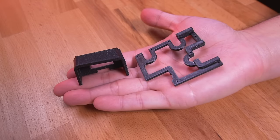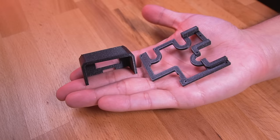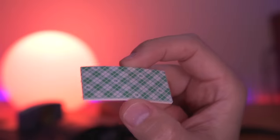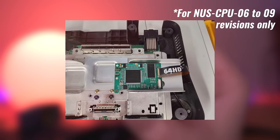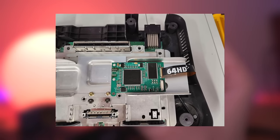Also included in the kit are both the AV shroud with a cutout for the mini HDMI port, as well as the booster bracket to support the HDMI daughterboard. The shroud was licensed from LaserBear Industries, and the bracket will actually be different from the one shown here, but it will be installed and function pretty much the same. Lastly, the kit includes two adhesive foam pads, which help install the mainboard on NUS CPU-06 through 09 model N64s, since they have a different heatsink and cannot be mounted using the existing screws.